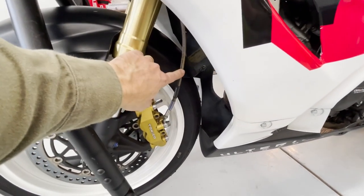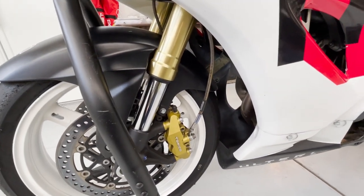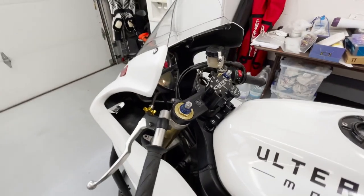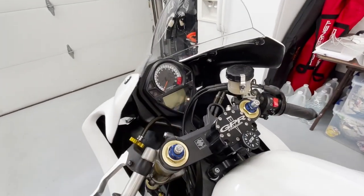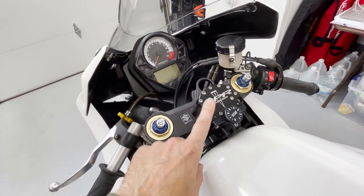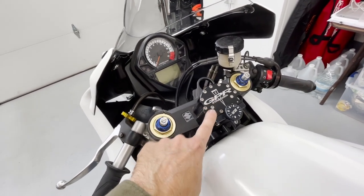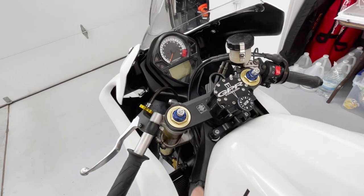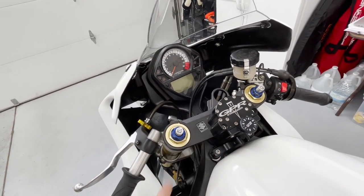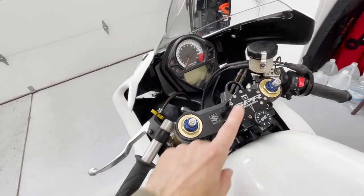I went with braided lines to reduce any swelling and give good feedback at the brake lever. I use all the stock gauges. I do use a steering stabilizer and highly recommend one. I was maybe on my second track day when I realized I needed one at Thunder Hill. Once you crest the hill on the gas, unweight the front end, and the bars start wiggling side to side — you're going to want one too.